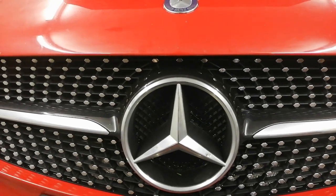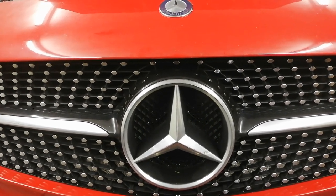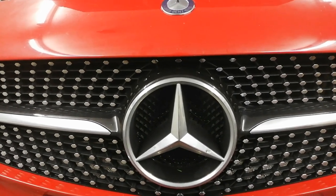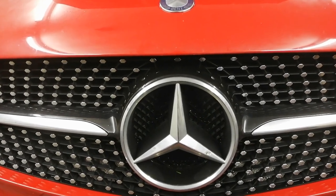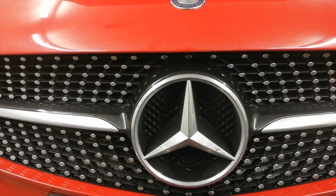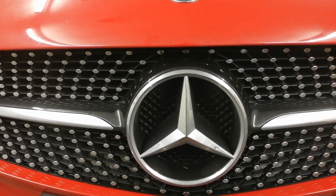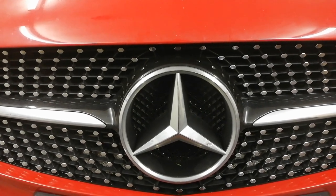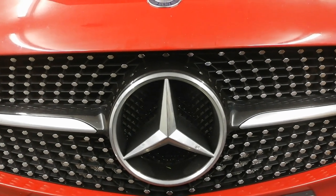So, all the best. Oh, here, before we go, I didn't mention, those brake pads there in particular, I couldn't see a different size of chamfer on them. And sometimes there's a wee arrow on it that indicates the direction. Those brake pads there were all the same. So, I deemed them as not being directional. Yeah, you need to look at them first before we put them in and deem whether directional or not.